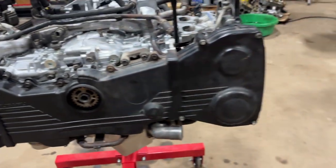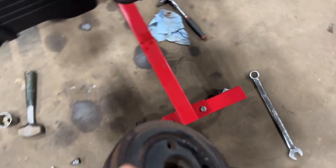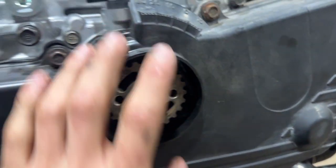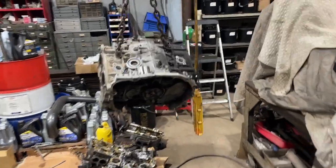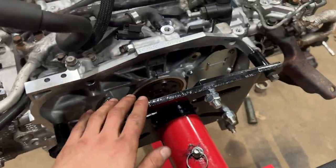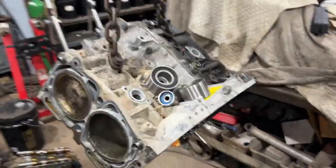Got the timing covers on. Now we're gonna throw the crankshaft pulley on - pretty easy to do. It's got a little keyway that lines up with the crank keyway, put it on, tighten the bolt up and it'll be all set. Got the crankshaft pulley on and tightened down. Now it's finally time to replace the old block with the new one. I'm going to put the clutch on now while I can, because I can't put it on when it's on the engine stand - I'll do it while it's on the crane.